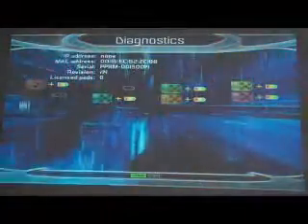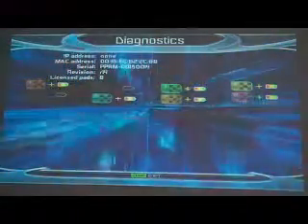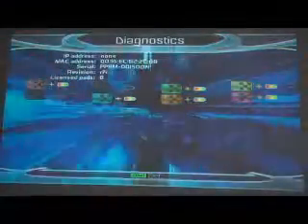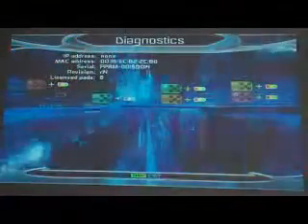You can see the number of pads. Some of them — two and five — are not on; they're probably sleeping right now, or their batteries have run out. It's easy to check — we'll just go step on them. Pads one, six, three, seven, four, and eight are looking good. The plus signs show you how strong the signal is — those should be steady. If pads are too far away or the antenna isn't set right, you'll see them wavering. The battery symbol should be full — green, yellow, and red. If you see red, the battery is running out. There are 900 hours on these batteries, and since the pads turn themselves off, you'll have no problem with them at first.